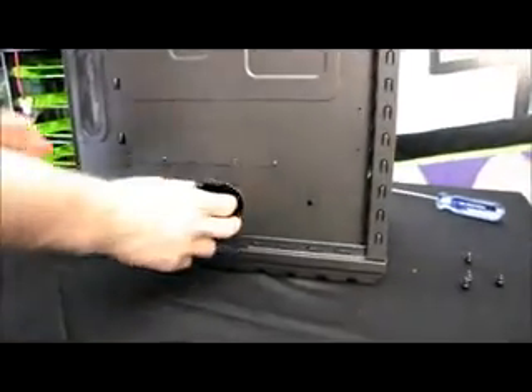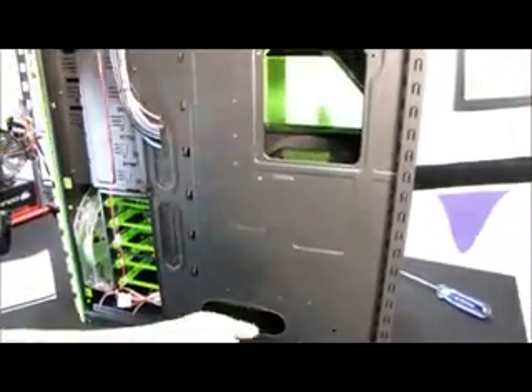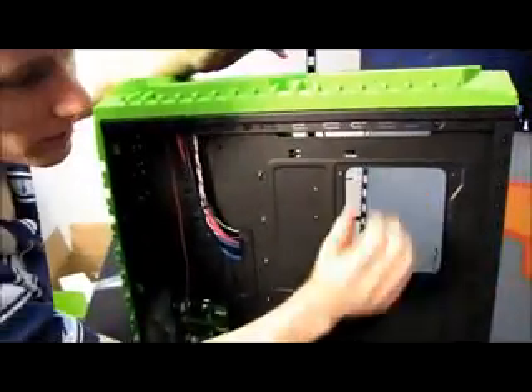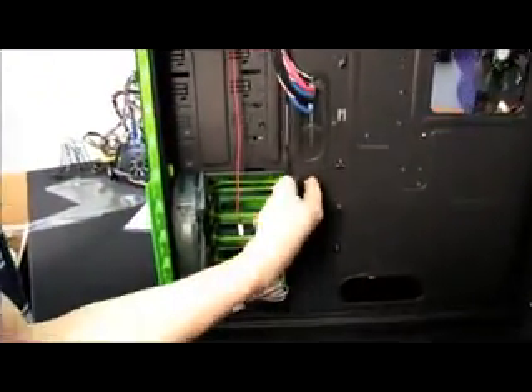There's a hole that allows you to take power supply cables and run them up the back — SATA cables over to the drives as well. There's the fan and the duct that goes on it to direct all airflow at your graphics cards. There's also a gap to route cables up to your optical drive to keep them nice and hidden. There's a cutout at the back of the motherboard tray that allows you to install and uninstall backplate-requiring CPU coolers without removing the motherboard. The silicone grommets are high quality — when pressed, they snap right back into place.